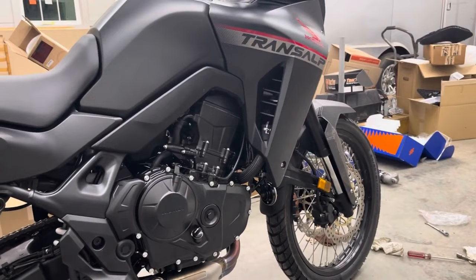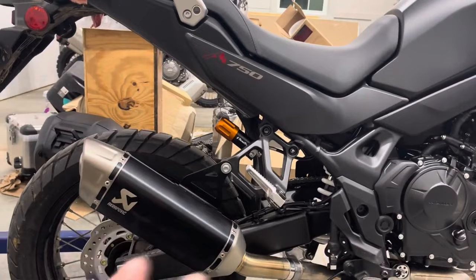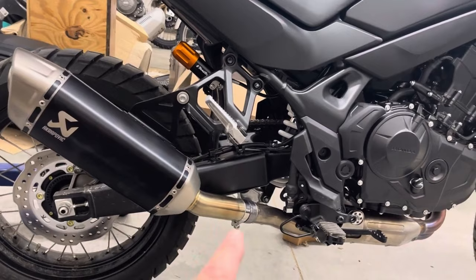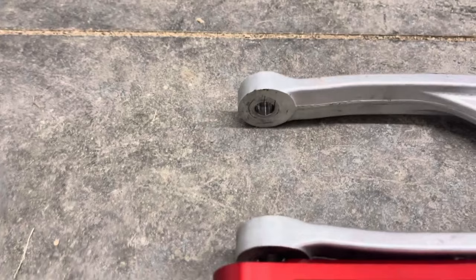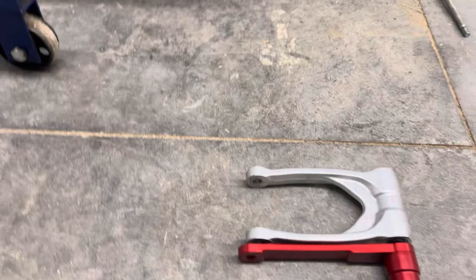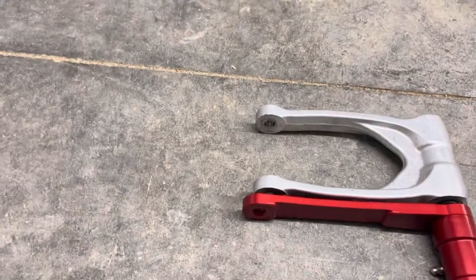And so that kicked it up enough — I won't say a stink bug effect, but it sits perfect when I've got the front forks matched. I bought it with the front forks and rear shock — that's the best thing to do. If you're going to do the suspension upgrade, no problems. If you want 25 plus millimeters of travel on the back, you'll have to do the same for the front. It is taller than my Tuareg, believe it or not. It's 15 millimeters more travel than the front, whereas before it was 10 millimeters less travel than the front.